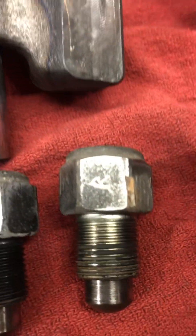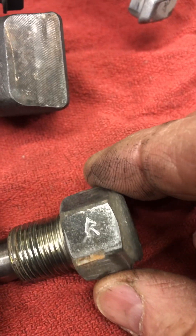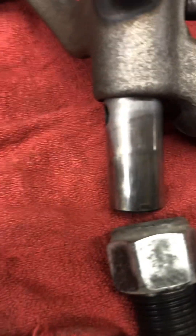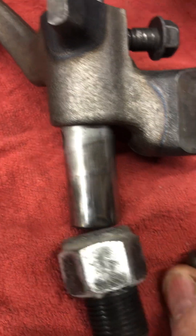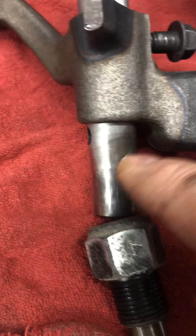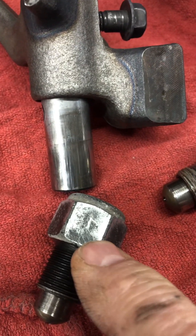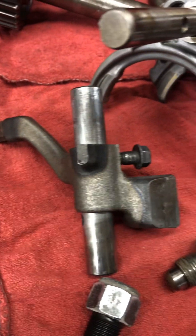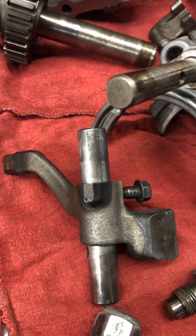When you're taking these apart, I take a little die grinder and mark these plungers that push on the side of the shift lever on the outside of the case — which side is right and which side is left — because there's a different amount of spring tension on these plungers and it will make a difference in how well it works. This one's a lot stiffer on the left side than the one on the right. We'll start assembling this and follow up in a video after this. We'll call this Part One AX5. See you next time.